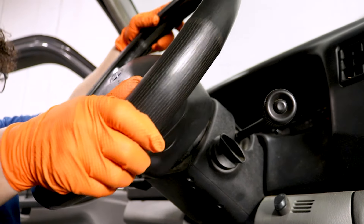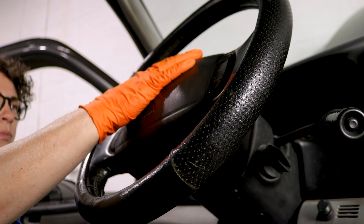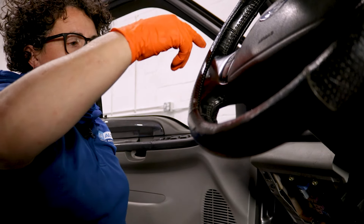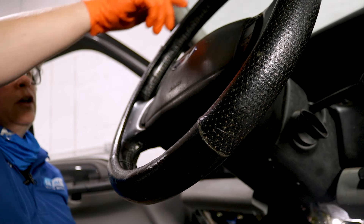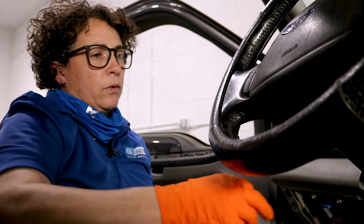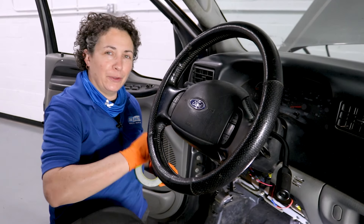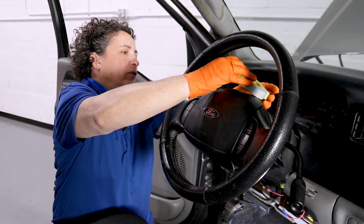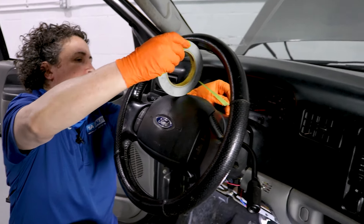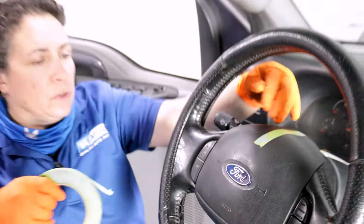You want the key out and the steering wheel locked. The reason for that is because you have your clock spring in there, and if you undo the steering column this thing wants to spin. If it spins one and a half to one and three quarters turns, it's going to rip that clock spring — then we went from an easy job to a miserable job. So because our steering wheel will not lock, if yours does, make sure it's locked. I'm just going to tape it with some quick masking tape.